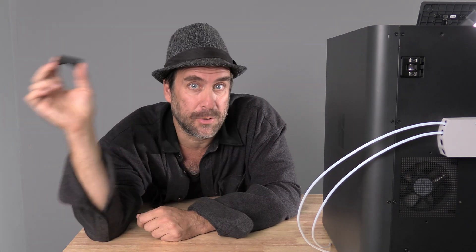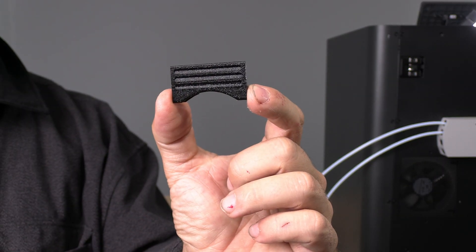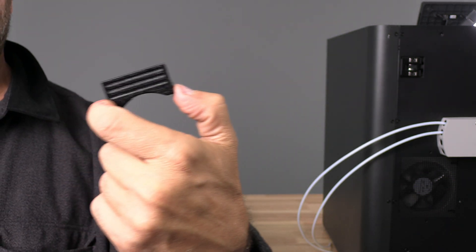Bonus round. Despite keeping the Bambu Lab poop chute in good working order, I still find, and many others still find, the poop chute tends to fail. It will clog and fill up and then knock the cover off your printer and ruin your print. Some people believe the trap door sits too low, allowing filament strings to get over the top of it, causing it to hang instead of fall, and then the rest just builds up. You can extend the height of the trap door with one of many community modeled 3D prints. I printed it in PETG and will leave the link in the description. This simple little print snaps over the top of your trap door, extending the height of that door to prevent the poop from getting caught on the top, hanging and clogging your poop chute, and ruining your prints.